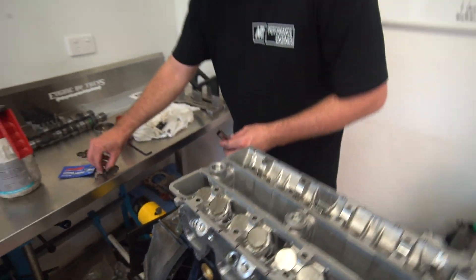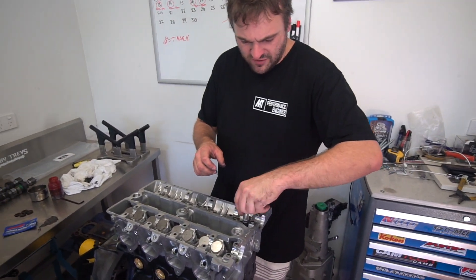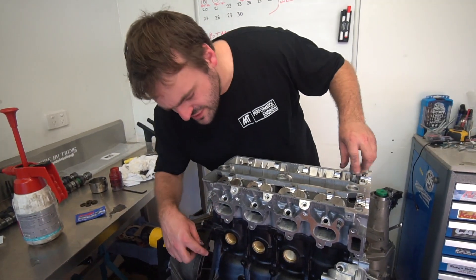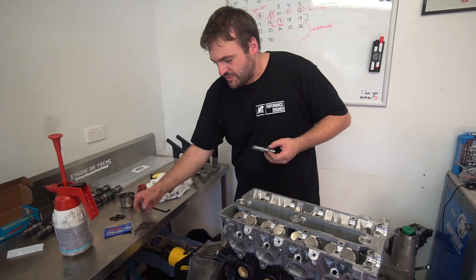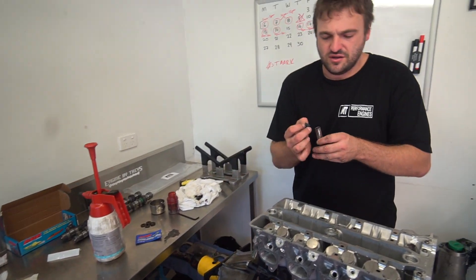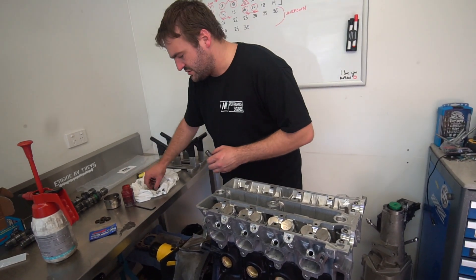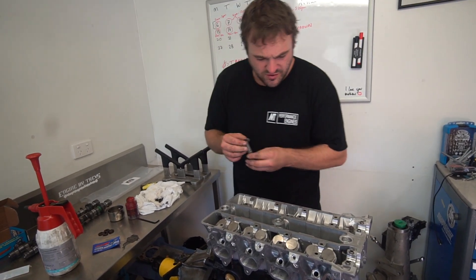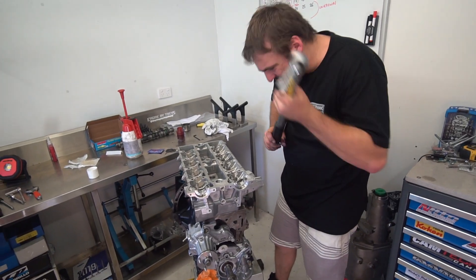The big port doesn't have that rear drain, and neither do 20 valves. But I have a jig where I actually drill into the back of the 20-valve cylinder head, bore in a fitting, and run it down to the drain port on the block where it's cast in. I drill and tap the block for the head drain, then run a 90-degree dash-10 fitting down to the drain. This helps the 20-valve not have breathing or oil drain-down issues.